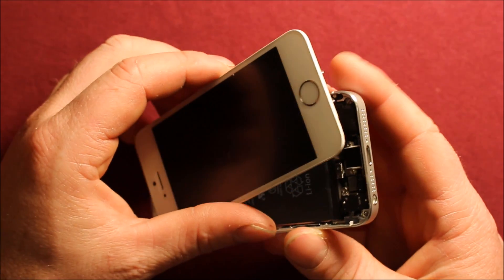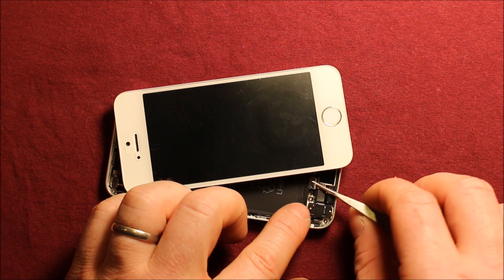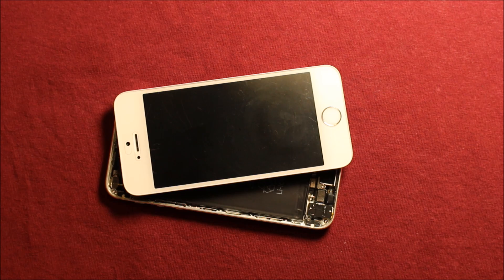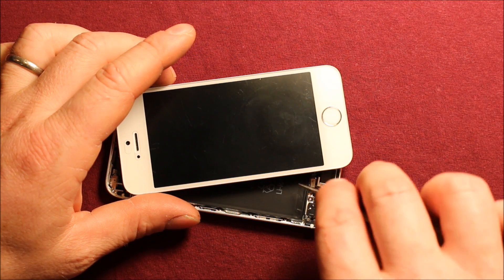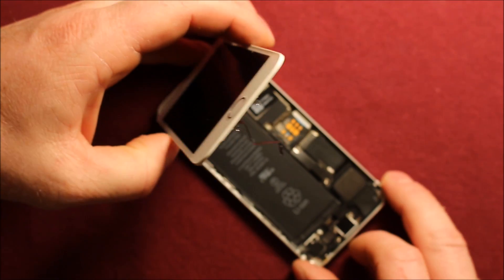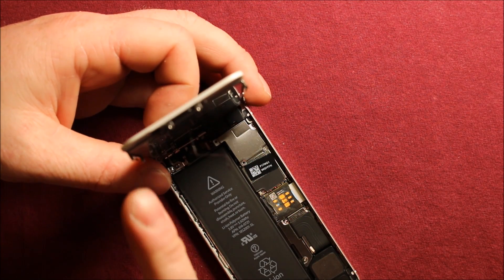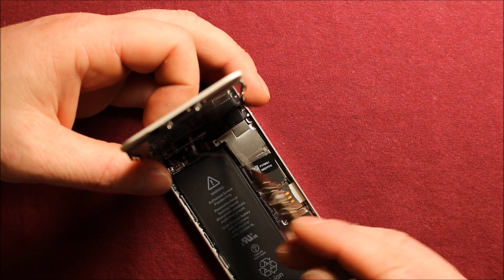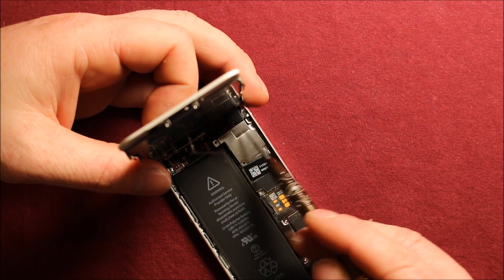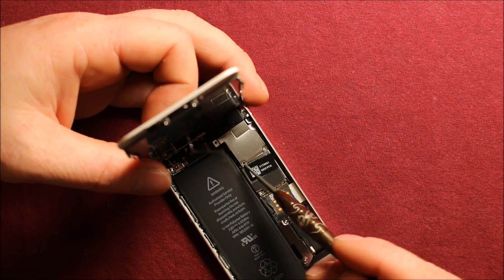So what you're going to want to do is lay this sideways to expose this connector right here, then pry up on this connector on one side and it pops right off. Then pry underneath this — there's a little connector right there, it just pops off — and then you can lift the screen up. Now without lifting the screen too high, you can tip it almost straight, but what we need to do is remove these four screws right here in this cover. You'll need to keep track of these so you keep them in the right order. The top two are not magnetic — if you have a magnetic tip screwdriver you can tell that way — the bottom two are.